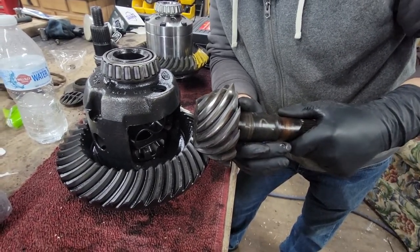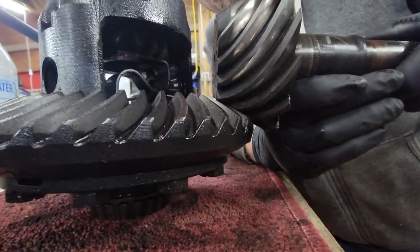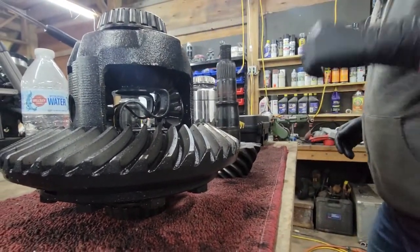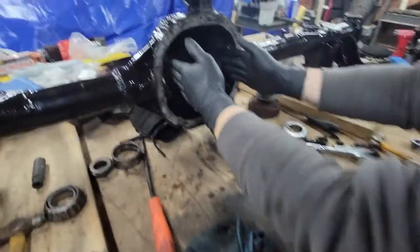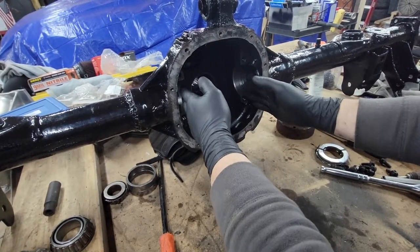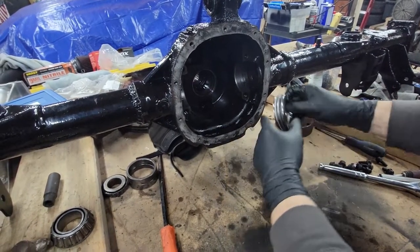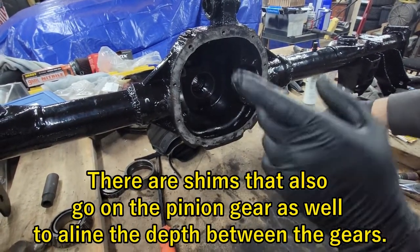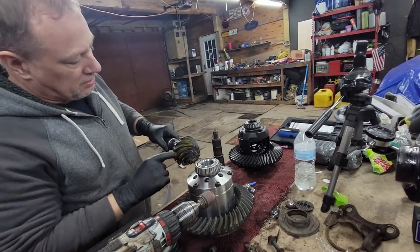Also, the depth height — if these gears are too far apart, zoom in on that. You can see how these gears are too far apart. That means the ring gear is over this way too far, or over this way too far. That's what the spacers are for on either side — the shims. They give you different sizes so you can either move it this way or this way as necessary to get these gears to line up perfectly, where the wear marks on the gears are correct.